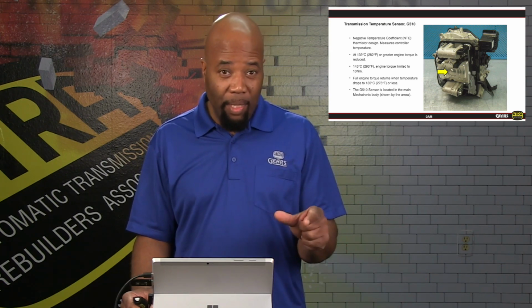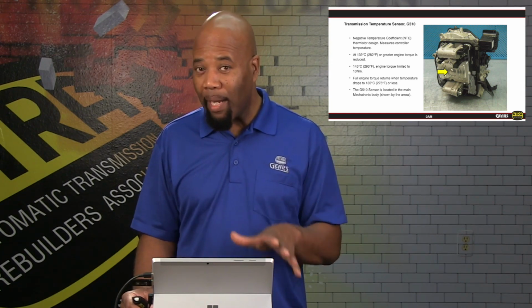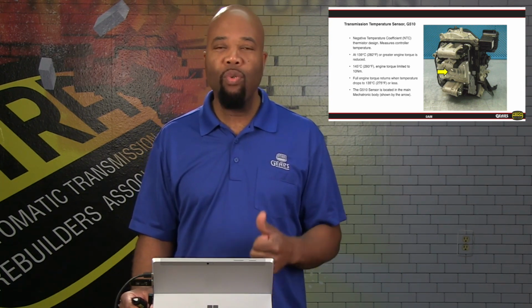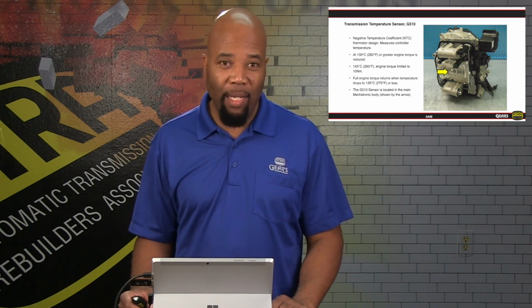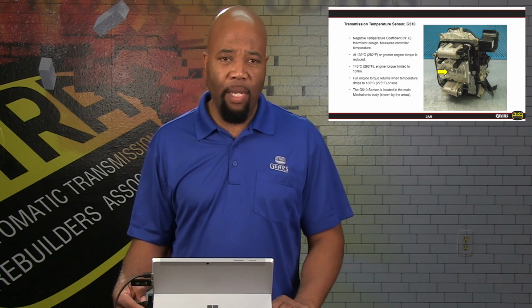This mechatronic assembly, unfortunately, as you see where it's located, the sensor is facing towards the gear train. So it might represent that the mechatronic itself is heating up excessively. Normally, if you run into a situation like this, you do want to check the level or the amount of fluid that is in the mechatronic sump. And of course, you'd have to drain that oil out and measure how much oil is in there and then refill it to the 1 liter specification that was presented earlier in this presentation.